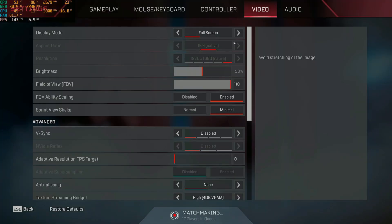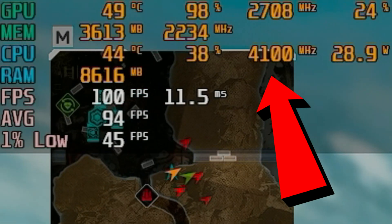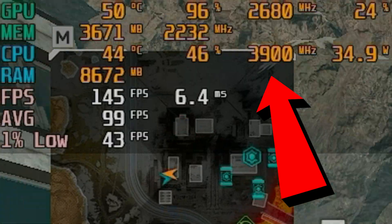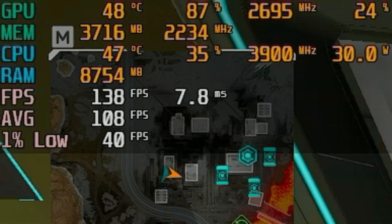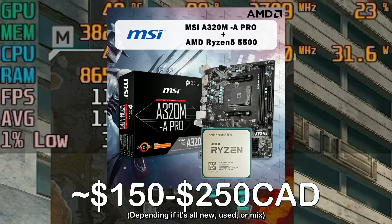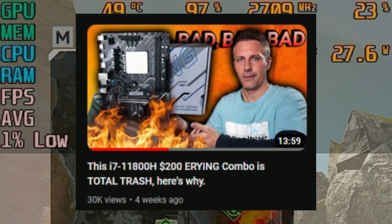Before this video turns into an RX 6500 XT review — if you're paying attention to the top left-hand corner, the CPU clock speed goes back and forth between 4.4 and 3.8GHz. This is because the VRMs are really bad, so you cannot maintain a proper clock speed at all times. The CPU utilization is already at a very low percentage, so you do not want to see fluctuating clock speeds like that. If you really insist on buying this combo instead of a Ryzen 5 5500 or 5600 with a cheap A320M motherboard, you'll have no bottlenecks pairing it with a card like an RTX 4070. For a more in-depth video on this combo, check out TechYesCity's video on this motherboard.